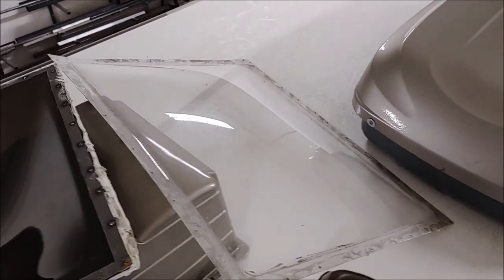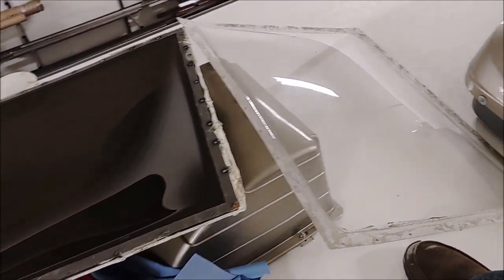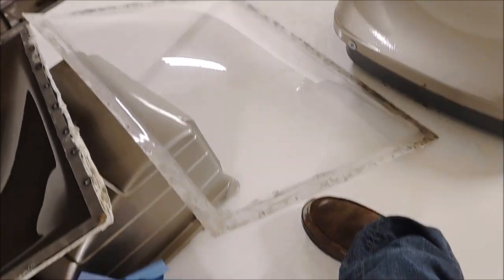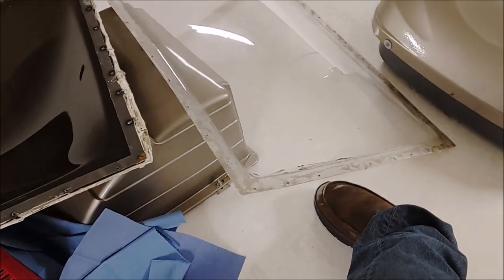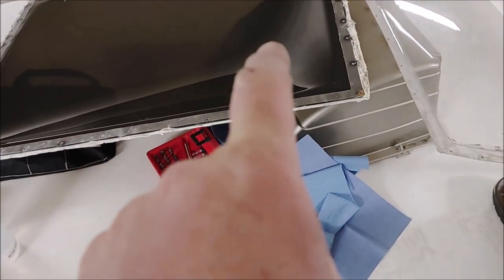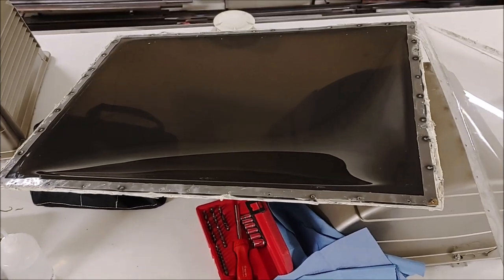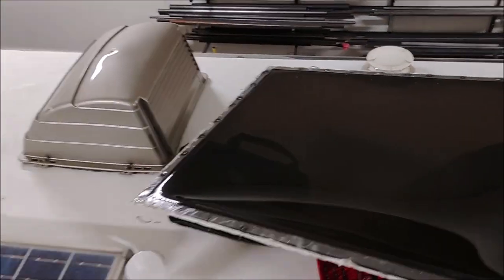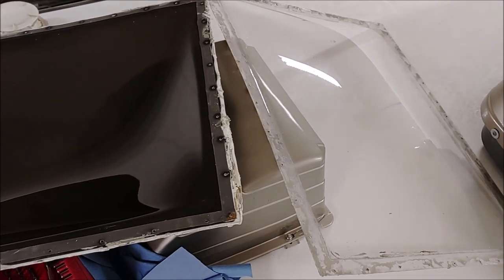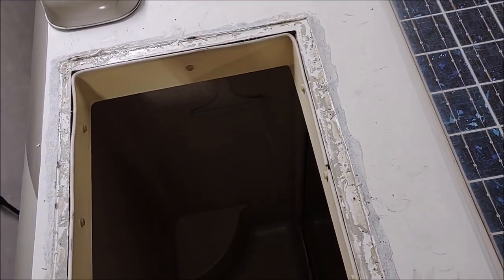I got the dome removed. The inner one separated — the inner bubble is actually still very pliable and I'm going to clean it up and reuse it. The UV must have attacked the outer one and saved the inner one, so it's in really good shape. I like this one a little better because it's not quite as much of a dome, so it'll create a bigger air gap. I got a clear one to go inside this one from a different vendor — I bought the outer one from Recreation Specialty and the inner one from Icon because the dome height gave me a good two-plus inches of gap, which I prefer for insulation.